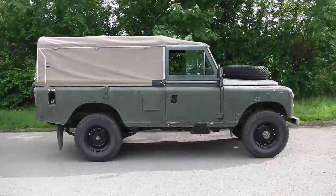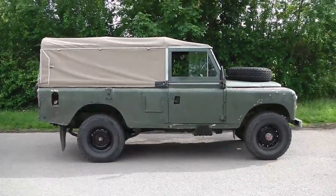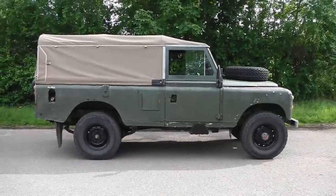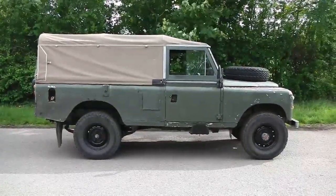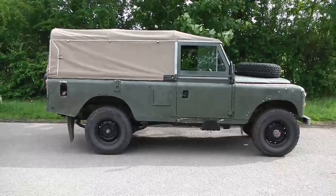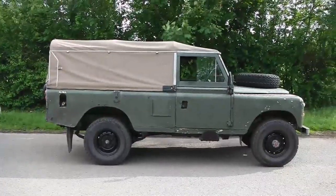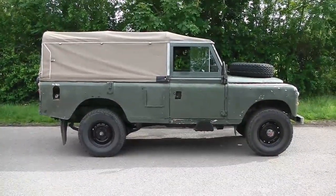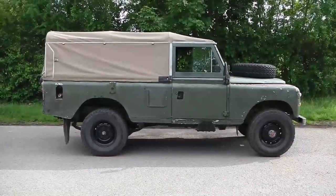So not a lot more to report really — very much better for all the improvements. The long-range fuel tank seems to work fine; unfortunately there's a slight leak from the sender, so I've got to run it down a bit and then drop the tank out again and change the washers I used on the screws for the sender — that's all it is, but it results in a slight petrol smell in the cabin. Otherwise, a few long-distance trips to steam rallies to go to, and then hopefully at the end of July I'm taking it to Brittany, going on the overnight ferry, arriving at St Malo — should be a little bit of an adventure, kind of a build-up to the big trip next year. I just wanted to show you that winch really, but the Land Rover's going along well and I'll be sure to take some film when I try the winch. Thanks for watching.